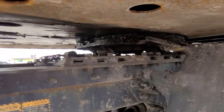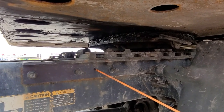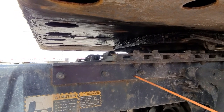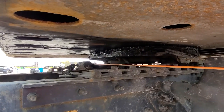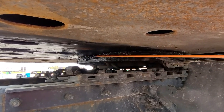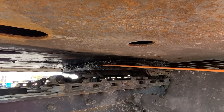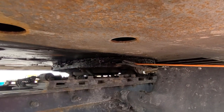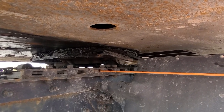Now we go underneath. Our platform: all bolts secured, not missing, properly attached to the frame, not damaged. Our mounting bolts: not missing, secured to the frame, not damaged. Our sliding mechanism: not missing, not damaged, no air leaks. The fifth wheel skid plate: no gap between the skid plate and the apron, properly greased, no missing pieces, not damaged. Our release arm: safely locked and secured. Sliding fifth wheel locking pins must all be locked and secured. Proper clearance from the back of the tractor to the landing gear.